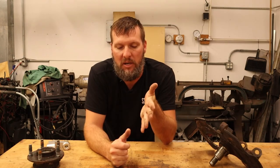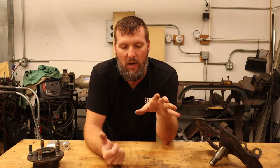As far as geometry goes, that is something I'm still trying to figure out. The Mod Squad Garage, Griggs, and Cortex spindles have preferred geometry for racing — a much lower kingpin or steering inclination angle, and a spindle drop to lower the car without really affecting the suspension geometry too much. Those things are all preferred but at this point I can't really achieve that, which leads me to the spindle I plan to use.